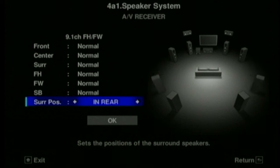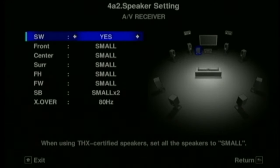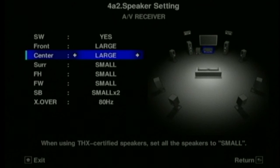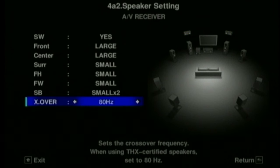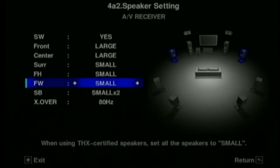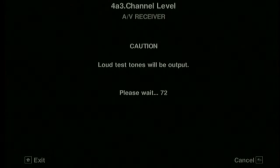Here you also select the positioning of the speakers. This is if you're going to have 9.1 channels of amplification used in one room. Here's where you set up the different speakers - you set the size of the speakers, whether they're satellite type, small speakers, or large full range speakers. This determines how much bass goes to the subwoofer and what frequencies go to each speaker. If you're using a full size conventional speaker, set it to large. Even bookshelf speakers I would still set to large, but if it's a sub-sat package I would set it to small.